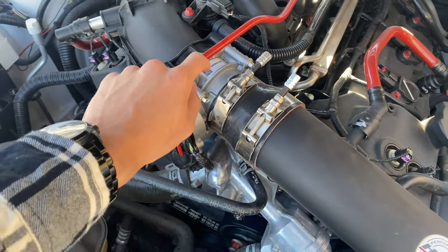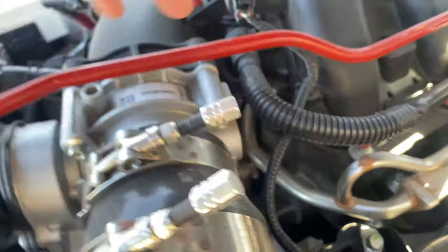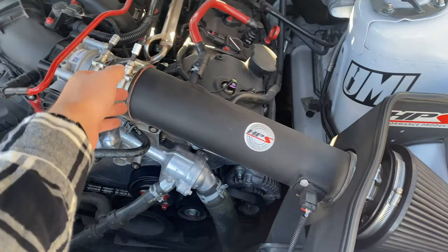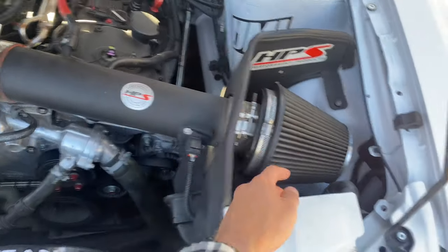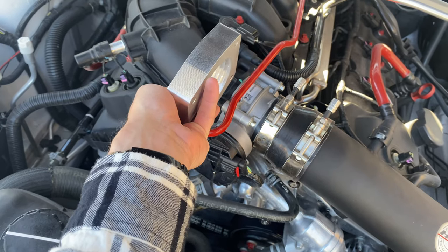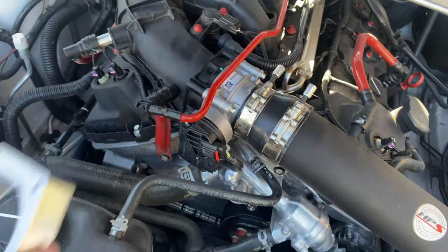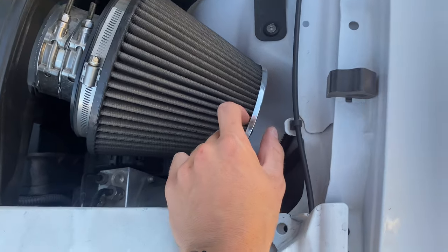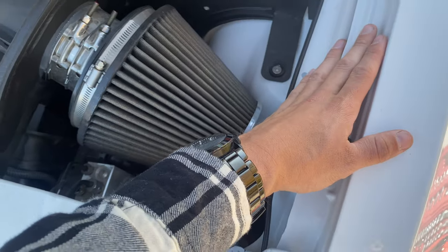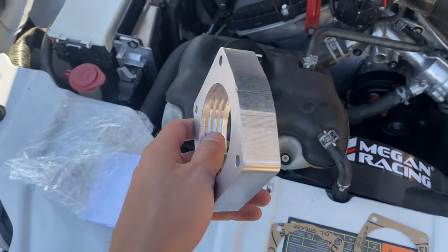This is pretty straightforward. All you have to really do is take off the four screws on each end — there's one here, one here, one down below, and on the other side there's one tucked right under the cold air intake. The only way to get to that is by taking off the cold air intake itself, because this whole thing's going to have to be shifted forward. You have to compensate for the fact that with a one-inch throttle body spacer going in between the throttle body and intake manifold, this whole assembly is going to be shifted forward an inch. I ended up measuring from here all the way to the body of the car to make sure my filter wouldn't end up hitting the fender.